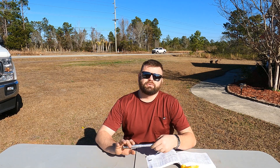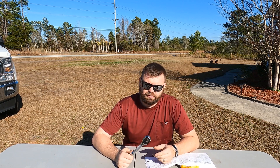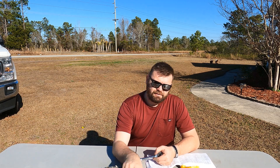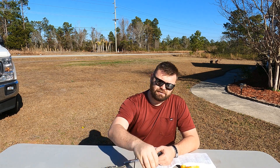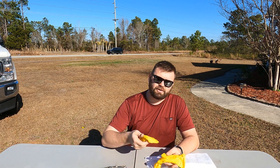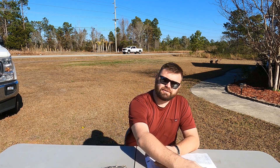Welcome back. Today we're going to be doing a fuel filter change on our diesel Jeep Wrangler. It's a pretty easy task. You're going to need some simple hand tools, or if you want to use an impact you can. You'll need a 1 1/8 socket for the actual fuel filter housing and a 10 millimeter to take off the armor that's protecting it. Don't forget your socket wrench, and I recommend a pair of gloves because you might get your hands full of diesel.